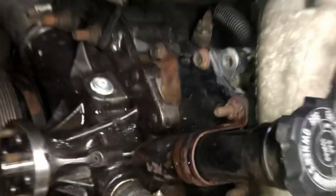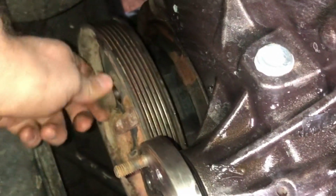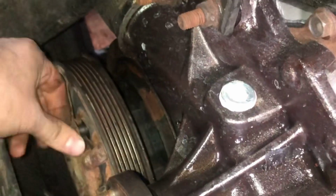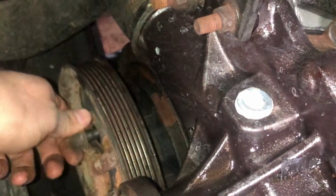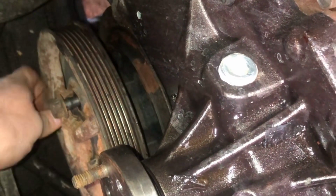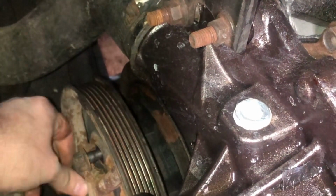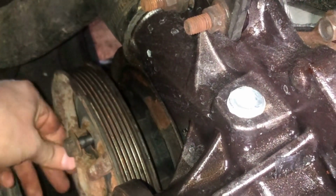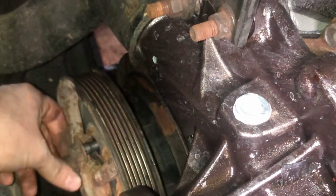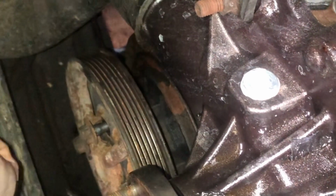All right, fan shroud, fan, belt, meet floor. Okay, so you've got 4 15mm bolts that have to come out of the pulley, which I already knocked loose. So you get these out, and that frees up the pulley. So you can then slide the pulley out and get down to your harmonic balancer bolt, which is a 24mm, and that one you have to chain the balancer to something to prevent it from walking off. So I'll get these out, we'll pull the pulley off, and then I'll show down below.